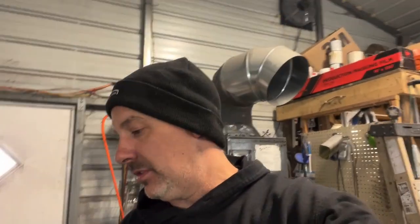So this morning I went out and started it and it was making a noise. Press the clutch, it goes away, which is typically a throwout bearing, but it could be the gear rattling in there. It could be that the fluid is too thick, and when it's cold, it's just too thick, and it's causing a little bit of clatter in there. It don't really sound like a throwout bearing. It's not the squeaking. It's more like mechanical noise, you know what I'm saying? So we think it's fluid, so we're going to change the fluid in it, and we also think it's got a bad CV, so we're going to change the CV in it. That's coming next week.